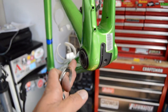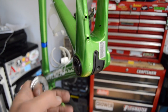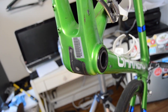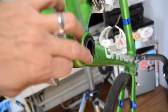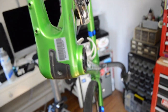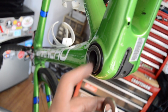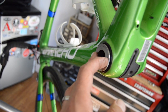All right. So in the case of this particular bottom bracket, this is a BB Infinite bottom bracket, which is basically a press fit 86 bottom bracket. Initially this bike was just gifted to me from a race team I was on. It came with a Shimano bottom bracket interface, so it's got a Shimano bearing on this side, and what I did, just kind of rigged it up, took the bearing out on this side and pressed in the GXP bearing with the 22 millimeter inside, and then this is our little dust cap that's going to go on the outside.